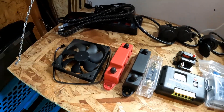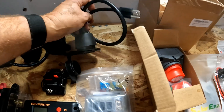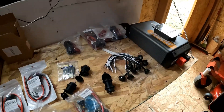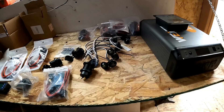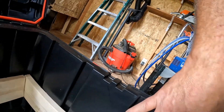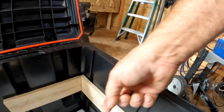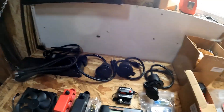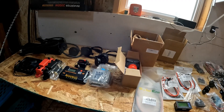I don't know if I'm going to use the fans because I thought they were temperature controlled. They hook together, so if I do use them I might need to put a switch on them. Then I have my AC outlets. The inverter has four outlets on it, so I'm going to run those through here with the inverter on the top shelf — they'll just plug right in. This also has a spot where you can run another cord through without pinching it, so I can plug a power strip directly into the inverter for lights, TV, internet, who knows.